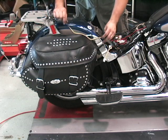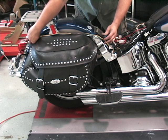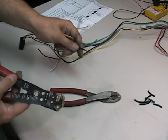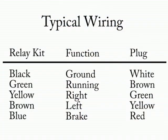Next, I want to size up the wiring that comes out of the relay package to see how much I need to add when I wire on the plug. When it's finished, I want the plug to come out somewhere near the hitch ball — it doesn't have to be exact. Now I'm preparing the wiring harness to add a plug. There is no standard among motorcycle trailer makers, so the color codes on the relay kit will not typically match up with the color codes for the plug you're going to attach for a trailer. For example, on the relay kit the black wire is ground, but on the plug I'm attaching, that wire is white. The point is: wire up by function and not by color. Your trailer maker will supply you with a chart so you can compare the colors and see what wire goes to what.